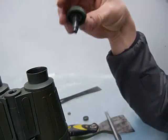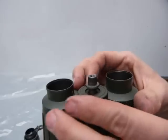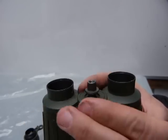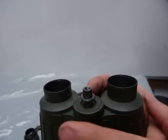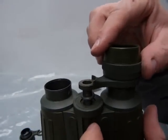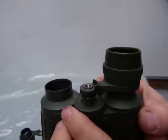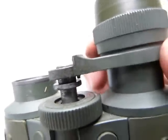I'm just going to tighten this bolt about that much and then place it back. I'll need thread lock for that final bolt — the source of the original grief. Make sure you put it in all the way, and then the left eyepiece with that index pin goes in to the left side and has to engage with the groove on that ring. Good — now it's in, you can see the pin going into the groove.